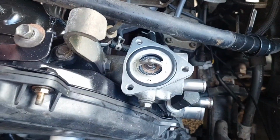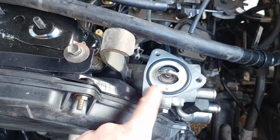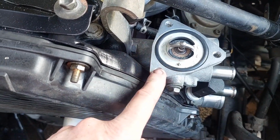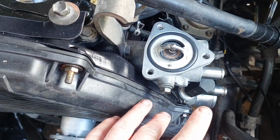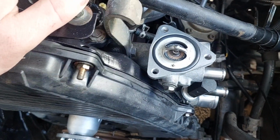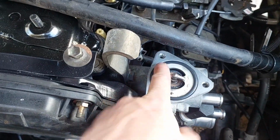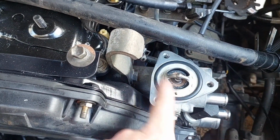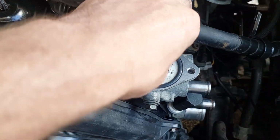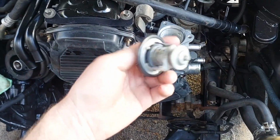Now I have drained this already, and I don't know why manuals do this, but they say take note of where the jiggle pin is. This is the correct position of how it's meant to be. Say you buy your car and you look at your Haynes manual, or whatever it is, some bozo could have put the jiggle pin up the top or on the side or just in any random spot. But it's correctly meant to be furthest towards the engine.